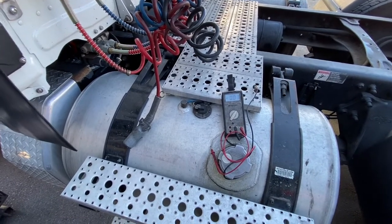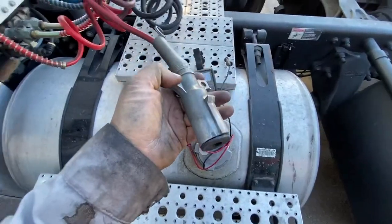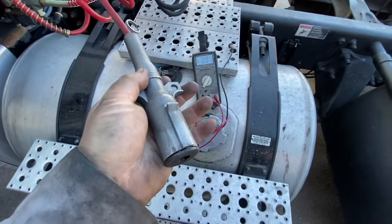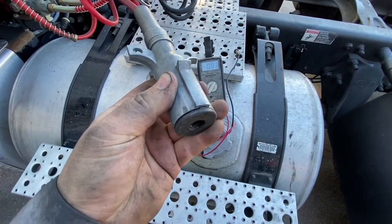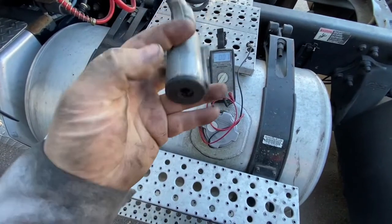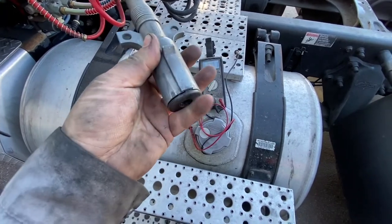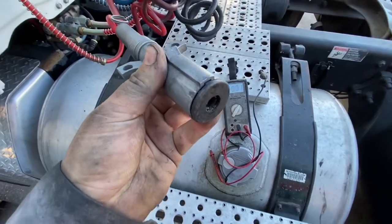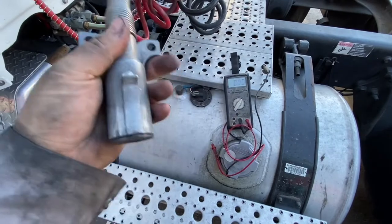The difference with a tractor-trailer is you've got a power cord that hooks to the trailer. I'm going to show you a picture of the power cord in the trailer. There are two different varieties: a single pin or a dual pin. The dual pin has two pins — positive and ground. The single pin is just positive and it grounds through the outside, grounding from the trailer to the fifth wheel back to the truck. The two-pin is just a more efficient way of getting ground.